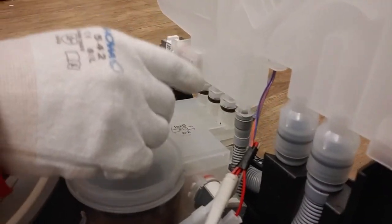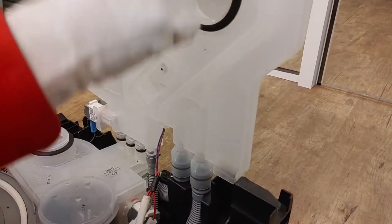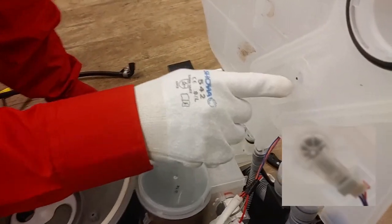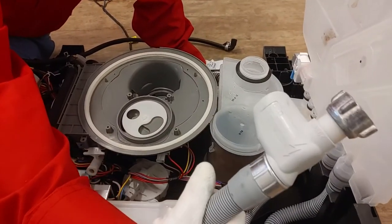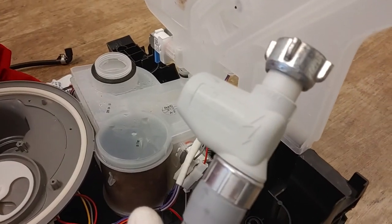When there is steam in the tub, pressure can build up. This pressure is reduced by a gap in the air and water guide, which may cause some moisture in the base or the side. When water flows in, it goes along an impeller which is connected to a flow sensor that counts how much water comes in. There is also a power line connected to a valve — when a leakage is detected, the valve inside blocks further water from flowing into the unit.